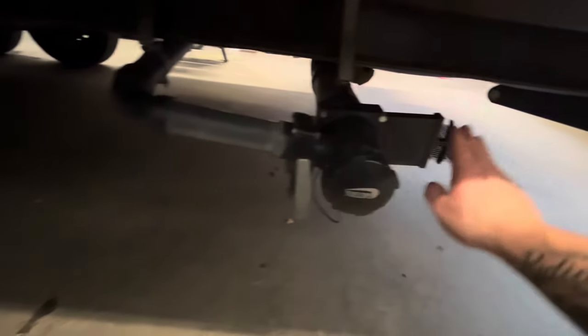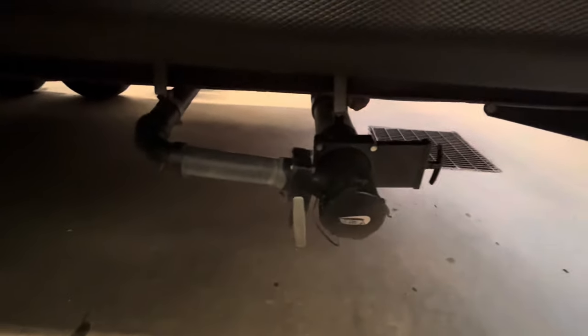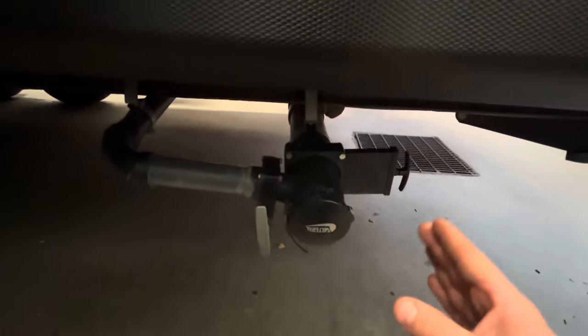Right back here, they are labeled up top. You have your gray tank on the left and your black tank on the right. The gray tank holds your sink and shower water; the black tank is your toilet holding tank. You have the gray tank valve here and black tank valve there — this side covers the bathroom sink and shower, and that one covers the toilet.